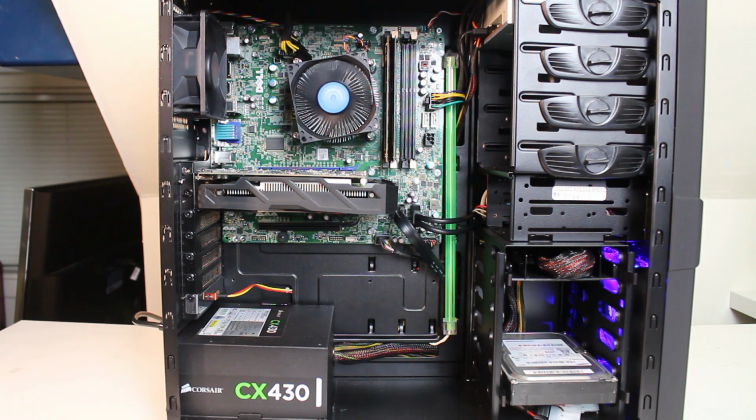It's really not a bad cooler at all, and after you clean it up and put a little sticker on it, it looks pretty decent. Especially with this motherboard, you can't overclock, so there's no need to invest any additional money into changing the CPU heatsink. Just clean it up, put on new thermal paste, and you're ready to go.